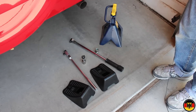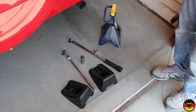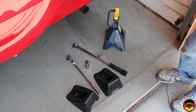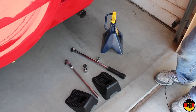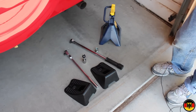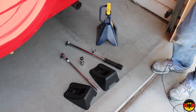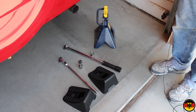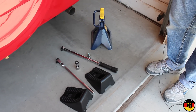What we'll do is jack up one side, since this is a ladder frame. It's not like — if you go look at my Toyota video on how to do the rear drums, you'll see I took the rear differential and put it on both jack stands and took both wheels off at once. This is a ladder-type frame, so it's not as easy to do that. I'll just take one wheel off at a time and show you how to pull the drums off and take a look. You can refer to my Toyota video if you want more information.